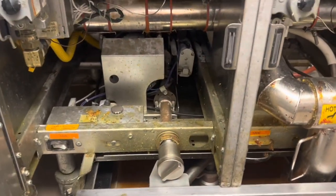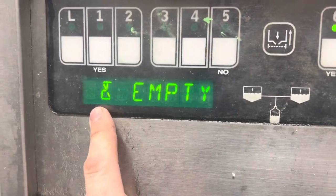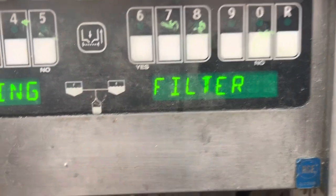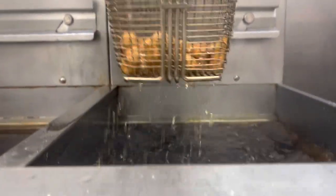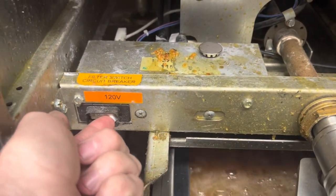I hate these auto-filtering systems. I'm going to drop this oil. Press this — it says filter pan in place and empty, yes. Now I'm just going to turn this off and filter. Starting filter — it's going to open the drain valve. You can hear that valve just open; now it's dropping the oil into the pan. It's set for auto filter, which it's not going to do because it's tripped.